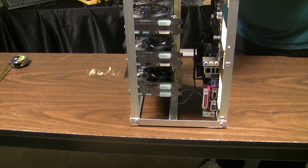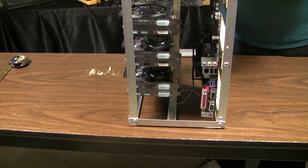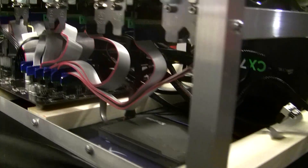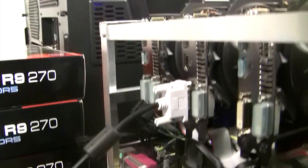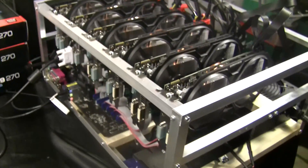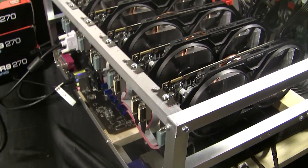The rigidness isn't really what we're focused on here — we're looking at good thermal design, putting six cards in and pushing air across them as they run at 100%. We also needed space for two PSUs. With six cards, we run into plug issues — it's not a matter of power; a 1,650-watt PSU could handle these six cards — but if we upgrade to 280s or 290s, we definitely need two PSUs.